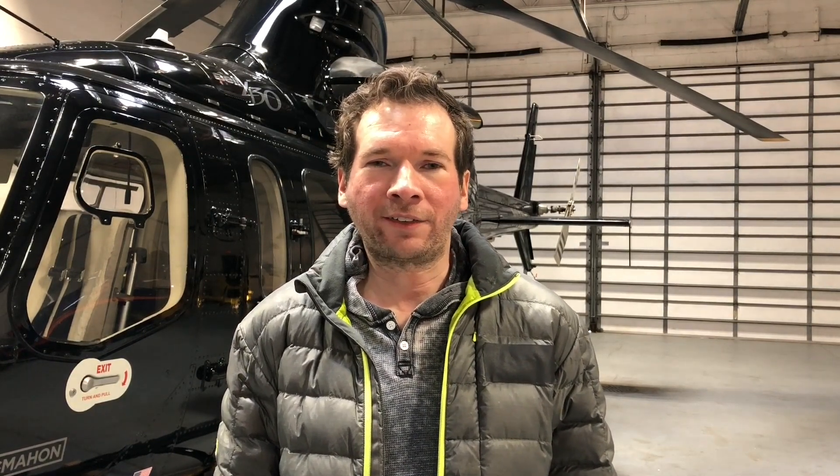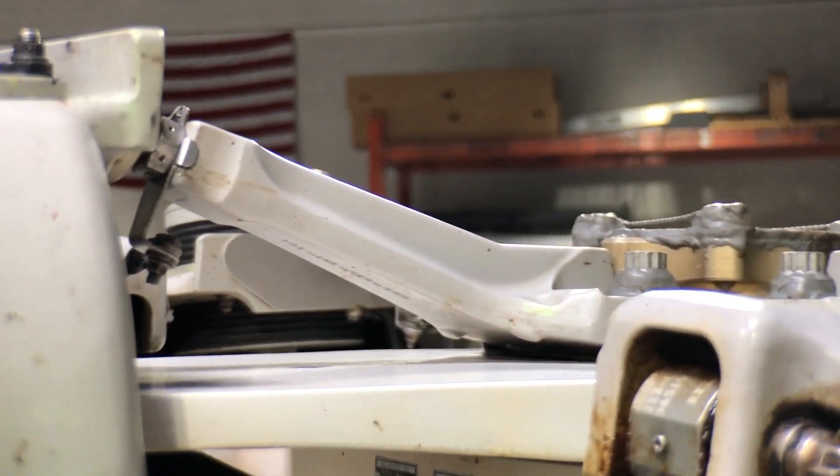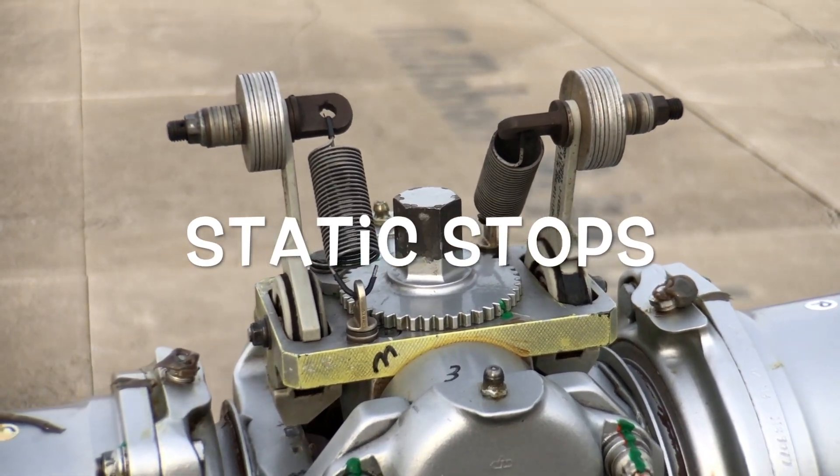I'm going to run through this calculation at the end of this video. The other question is: if the blades are free to flap down, why don't they just hit the ground when they're not spinning? Obviously when they're spinning they're coning, but if they're not spinning, why don't they just hit the ground? It's because of the static stops, which are these little flapping restraints — in the case of some rotor systems they're just a piece of metal, and in the case of semi-rigid rotor systems there are these bunny ears on the top.